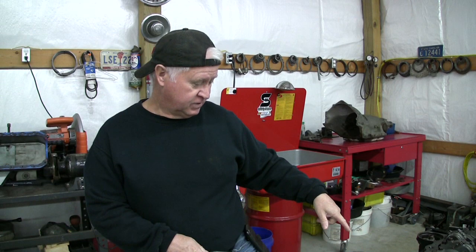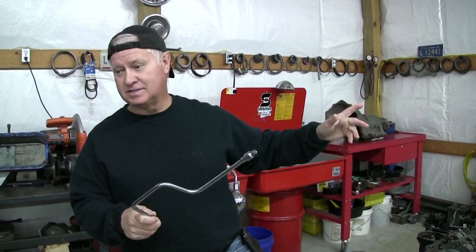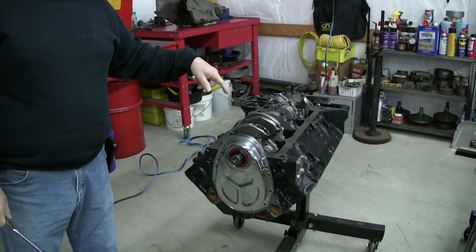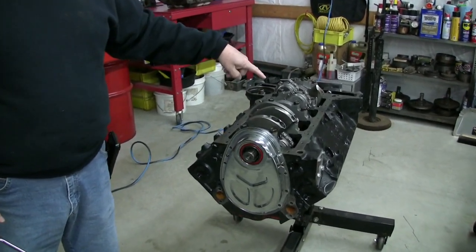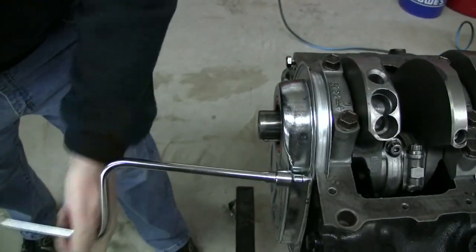Well, it's been two weeks since I got a chance to get back out to the man cave, and I forgot where we left off. I think we were tearing this engine down and looking at the pig in a poke. I'm going to pull off the timing gear cover next, take a look and see what we have. I hope we have a good double roller in here, but this guy's got so much mixed up, mismatched stuff. So we'll pull the cover off, take a look at that, and then we're going to measure the clearances. I'll show you a close up where I'm talking about measuring the clearances for the stroker crank. I see there's been some grinding internally on the block to clearance everything, and we'll take a closer look at that. Let's pull off the cover and see what we have. I'm curious to see what's behind the timing gear cover.